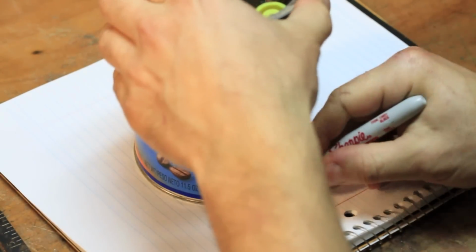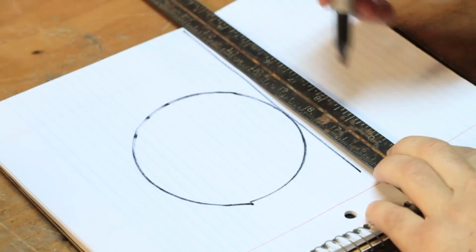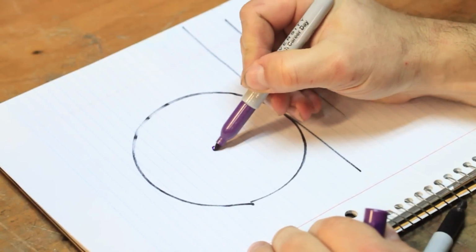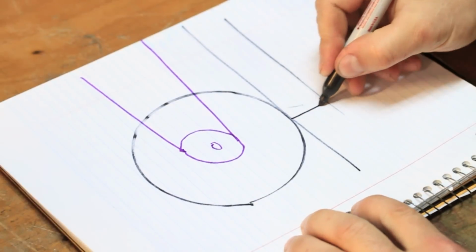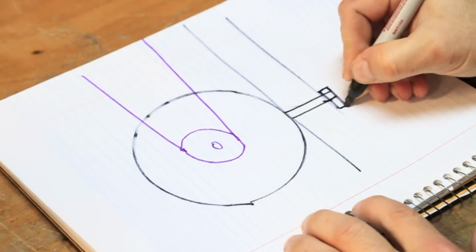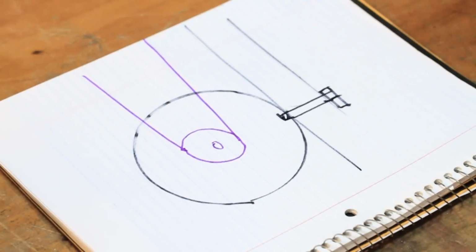Just to make sure everyone understands the way this is designed and why it's a problem, if this is the motor, and this is the side where it mounts, we're looking at it from the front. So this is where the belt would be. And the bolt that fails comes through this wall, has a nut on it here, and only came into the motor about 2 threads.